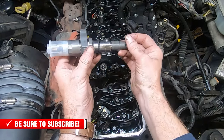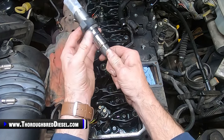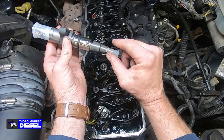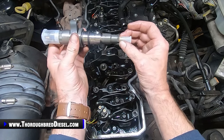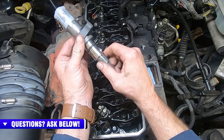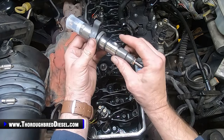On the injector, there is the feed hole side — this is where the feed tube engages the injector body itself. On the backside there's a hole for return fuel flow. That's why the sealing surface of the injector bore is so critical and the copper washer must be on the injector when you install it, because this seals the combustion chamber from blowing up around the injector body. If it blows up around the injector body, it's going to interfere with your return fuel and give you drivability issues. Most of your injectors are going to have different protective cup placements on them.